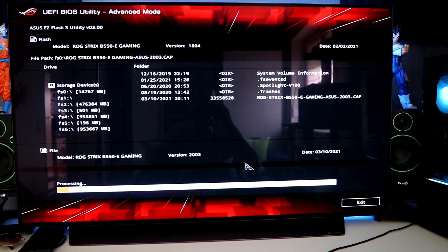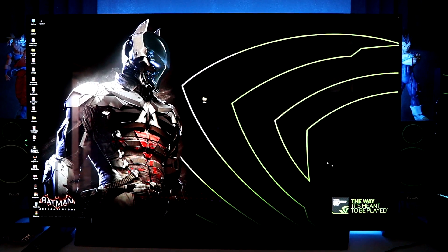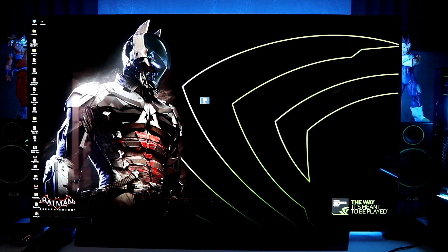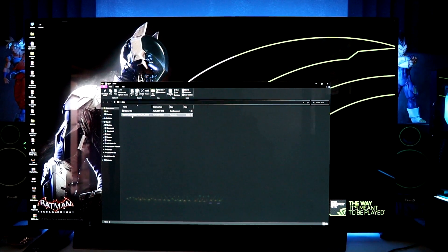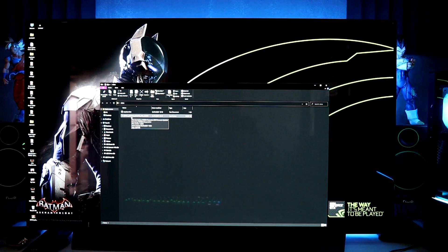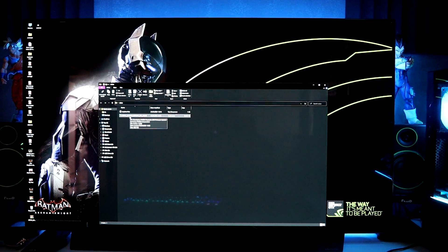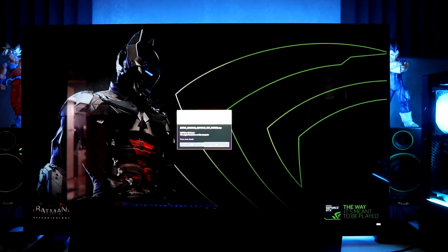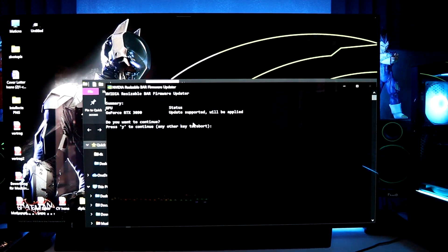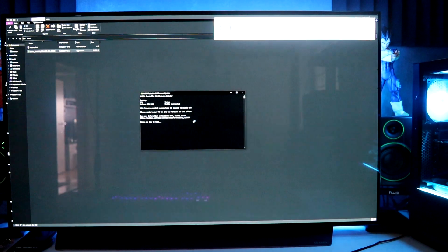When it's finished, we will continue. The BIOS update is installed and the latest drivers are installed. Now let's flash the VBIOS for the Zotac Gaming GeForce RTX graphics card. If you have another graphics card, you have to go to your manufacturer and download the same file. Do you want to continue? Yes. It is almost done — press any key to exit.